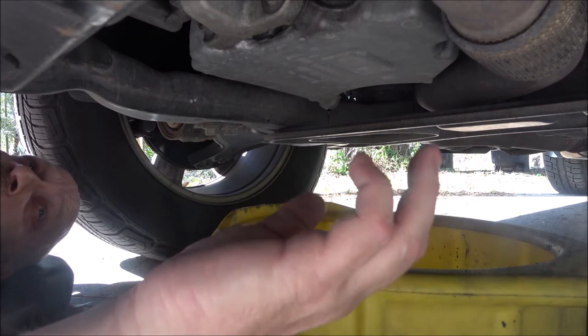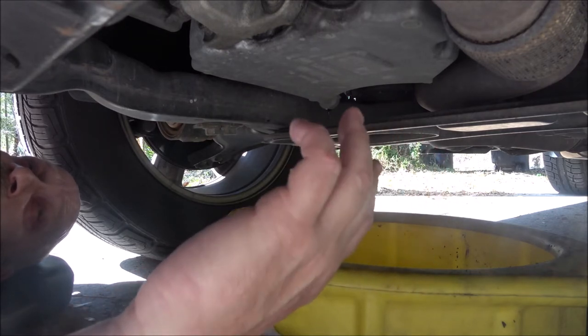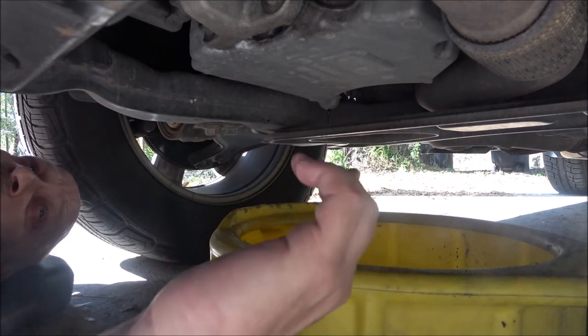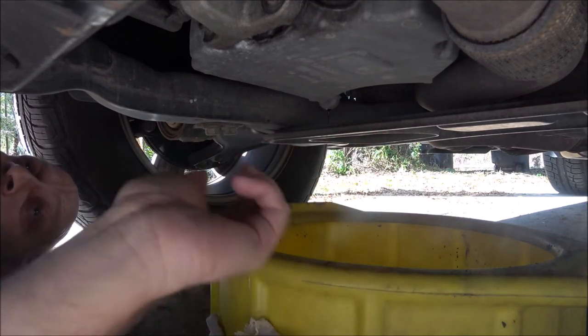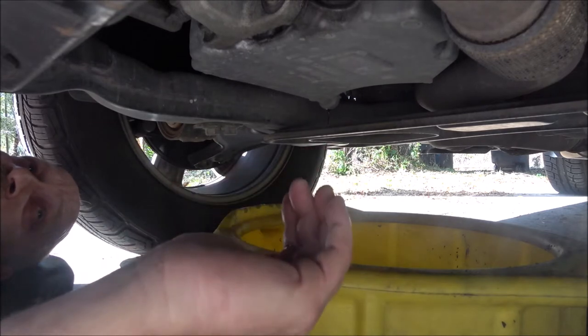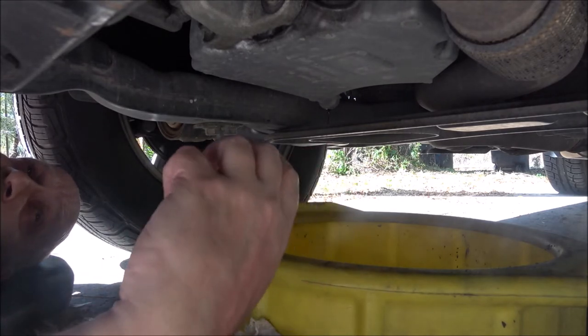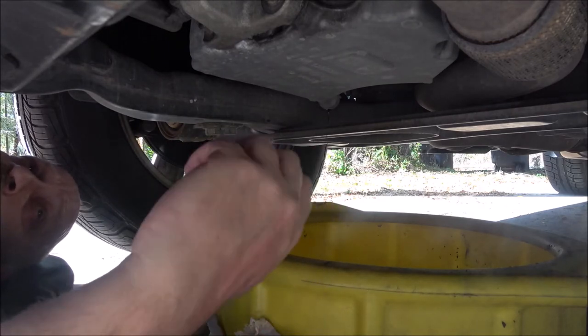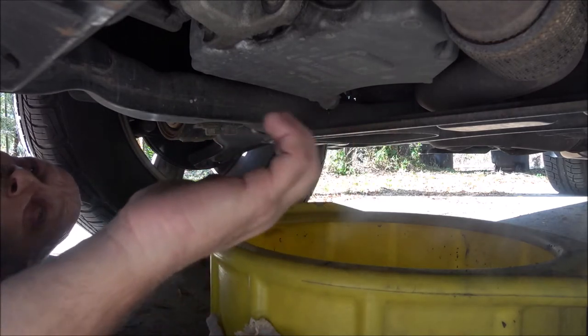Okay, if you got to put something on that gasket because it's leaking, you got other issues. What that's for is because you wipe all the old oil off, so you're not putting that up against the block, and you go to tighten it, it can rip that gasket. So the oil just makes the gasket slide, so you don't rip it putting it on.